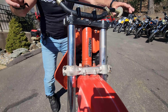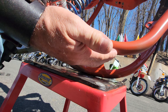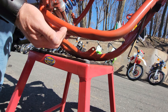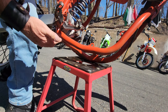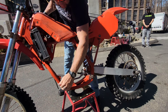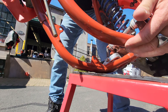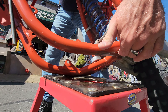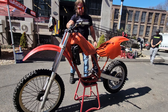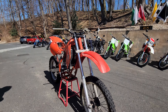I always like to take a look at the frame lowers — normally they're flat as a pancake. These are in good condition; there's one dent right here and a small flat spot right here, but no rust through on it. The other side is in excellent condition — no dents up front, one small one right here. Overall I would say these are in excellent condition, which is the main thing on a classic, because those are hollow frame rails and they rust out or cave in very easily.